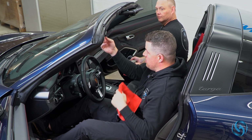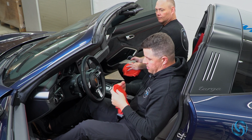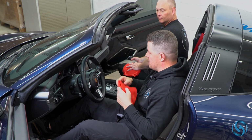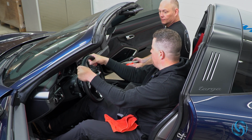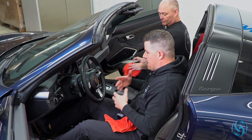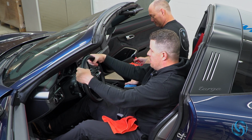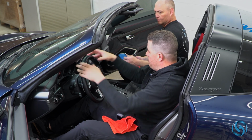For those that don't know, you can actually sand Alcantara, okay? If you have to get to the point of sanding Alcantara, you have not maintained it properly. Obviously, unless it's a heavily driven vehicle, it's got 100,000 miles on it and the Alcantara steering wheel right here is worn out. That's actual wear. But most Alcantara steering wheels, those cars don't get a ton of miles regularly. If they do, then disregard this. But this right here is going to get damaged by body oil before wear.